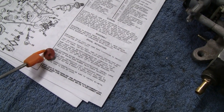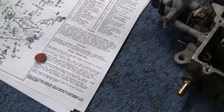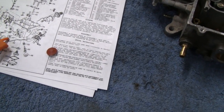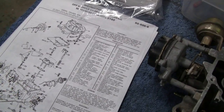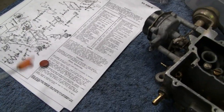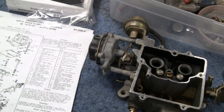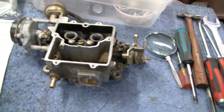Those valves must have been used on the earlier Motorcraft or Autolite. This is a newer kit, so the pump itself was probably updated — the accelerator pump too — but the one we have should work. Without this part I pretty much wasted my money on this rebuild kit. I'm going to clean everything up and put it back together, since the fuel pump inlet valve can be installed after everything else is assembled.